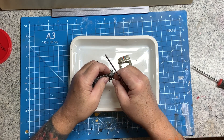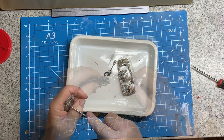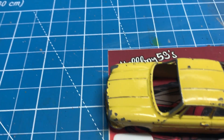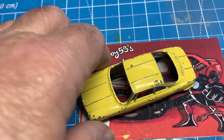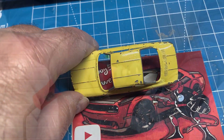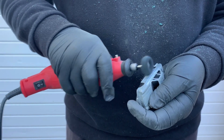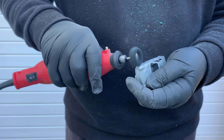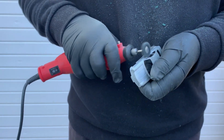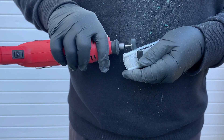And that's the first one out. Just get the other bit out now. When I stripped off the paint with caustic, this hard yellow gloss was underneath, which presumably was the ground coat for whatever chrome finish they used on it, so I had to resort to stripping that off with paint stripper. I was condemned outside again with my flap wheel, cleaning up the bodywork, because the latest bunch of brushes I bought are all disintegrating — and as you can see by the state of my jumper, that was not a desirable trade to be doing indoors.